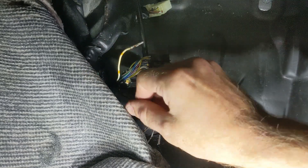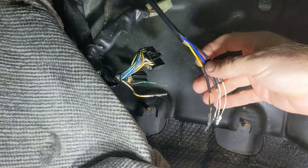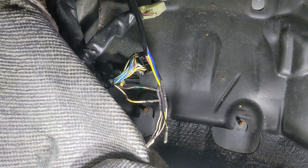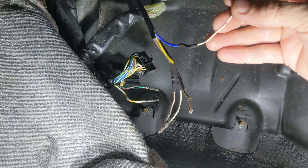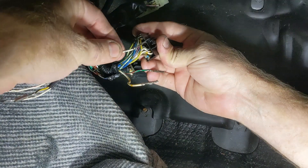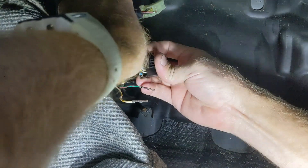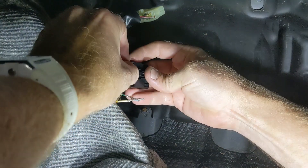I'll probably tape these off because I don't know what's going to those wires now. This is connector B — B5 is open. I need to locate my VTEC pressure switch, which I wrote down. B5 gets the VTEC pressure switch, and the oil pressure switch on my wiring harness is blue. I'm going to take this and install it into B5. Locked into place. B19 is the knock sensor. On my wiring harness the knock sensor is black. Snap that into place. Now I'm going to reinstall my retaining clip.